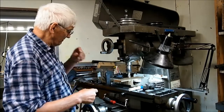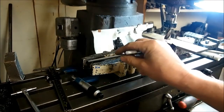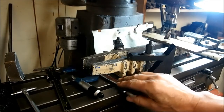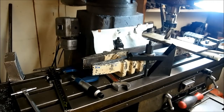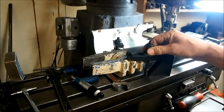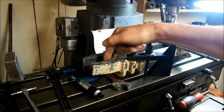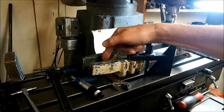So we'll come in a bit closer and I'll tell you what we're going to do. Here's the fork — we've got a little bit of wear on that side and similar wear on this side. The pin itself is 31.47mm, and the dimension in the fork is 32.25mm thereabouts. So we've got almost 0.75 of a millimetre excess clearance in here, which is far too much, and that's where my clonk is coming from, I'm sure.